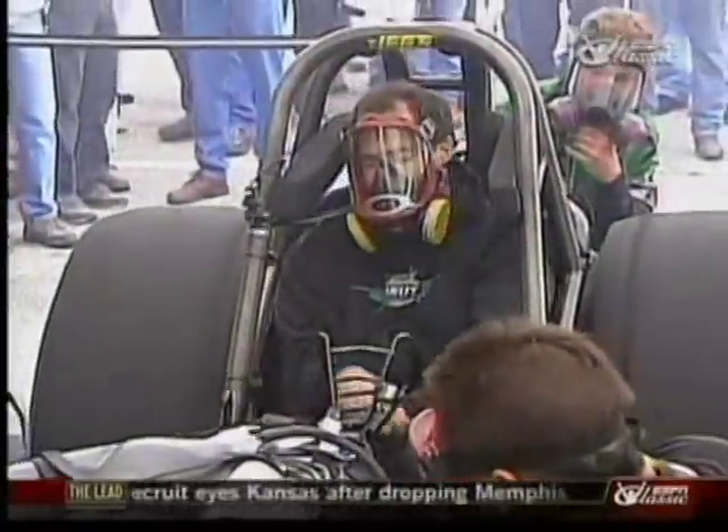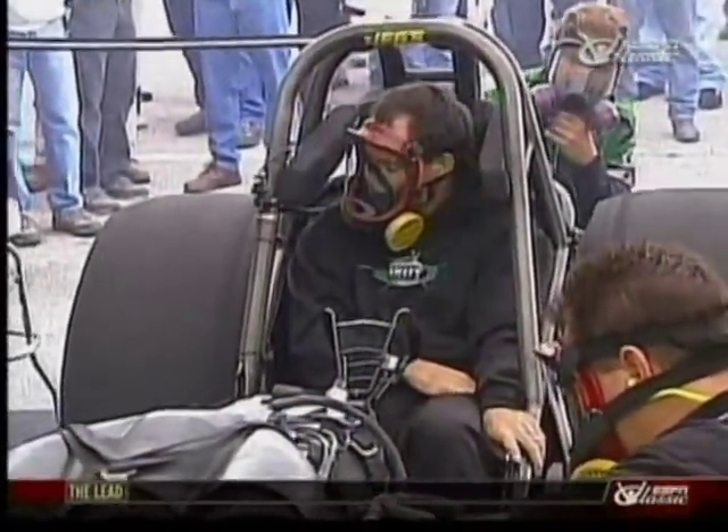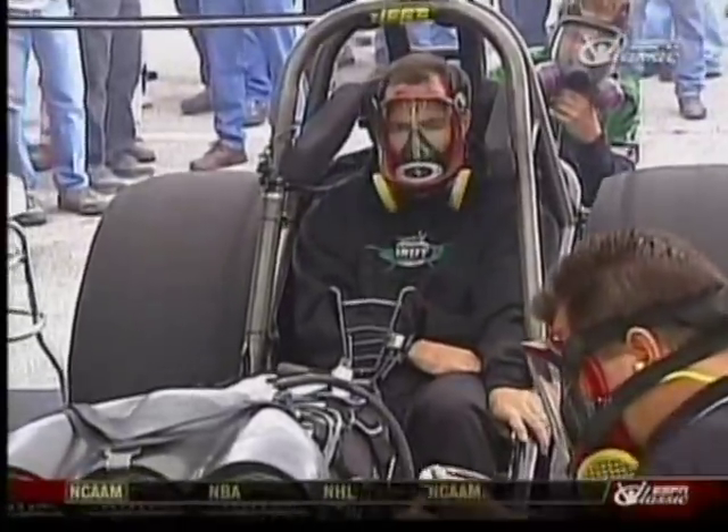When they're done with that, I'll flip the fuel off, let the motor come up, shut itself off, and then turn the ignition off once the motor's shut off.